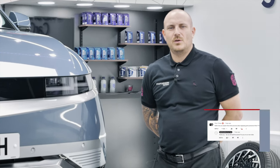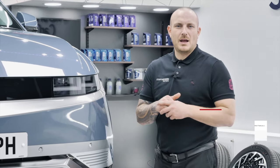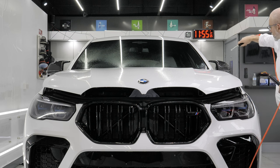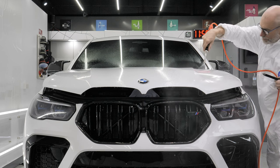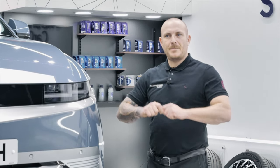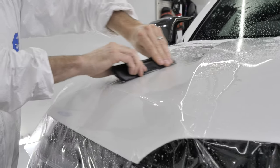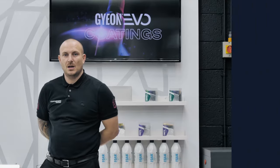Can we explain the full installation process of paint protection film? It is a lengthy process but we'll keep it simple. First, make sure the paint surface you're applying PPF to is utterly clean, free of products, greases, and dust. Spray your slip solution, squeegee, and repeat. Take your piece of film — whether a bulk piece or a pattern — lay it down and squeegee the water from underneath until it reaches all the edges, then wrap or tuck the edges where possible.